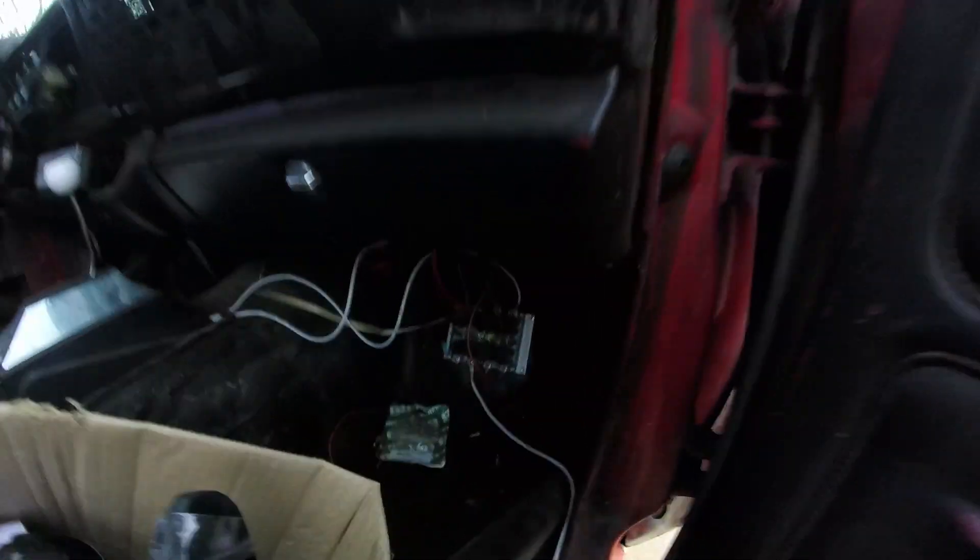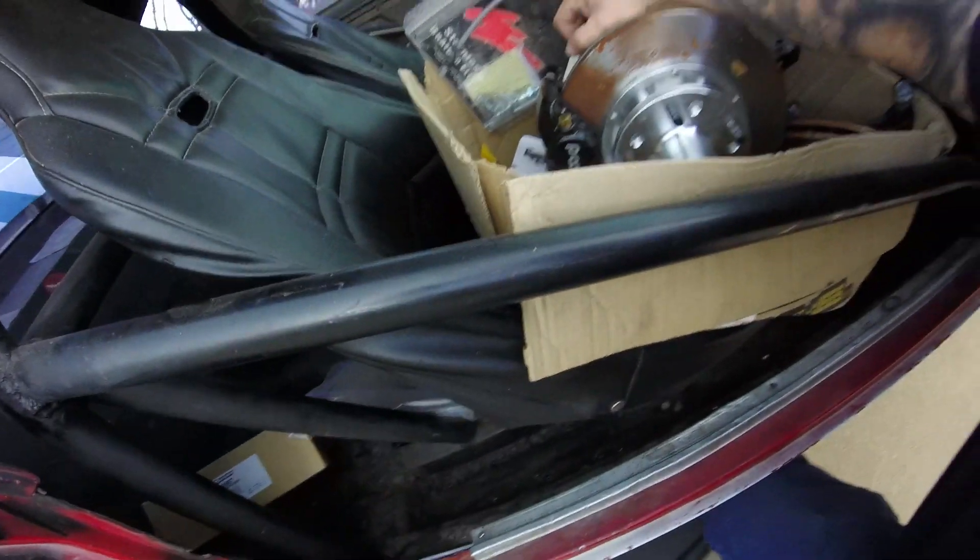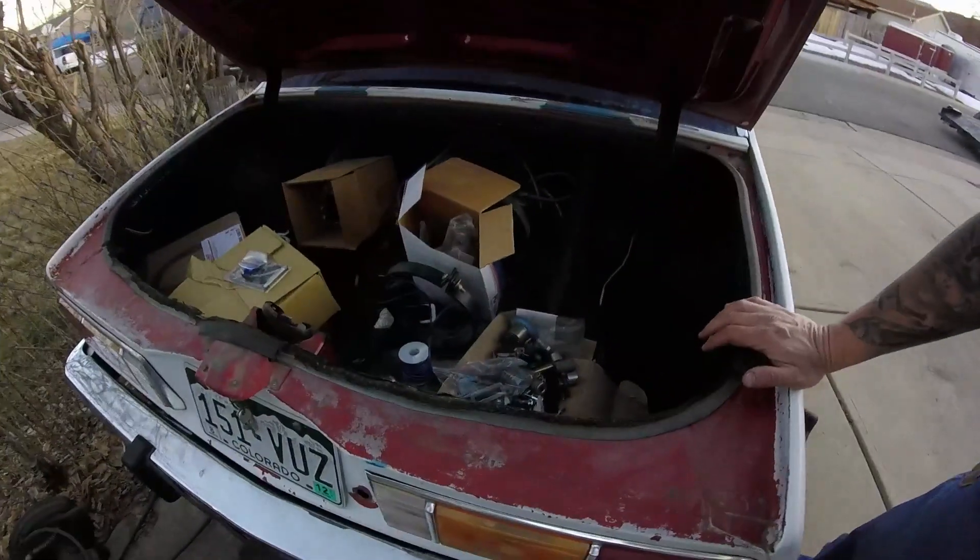No creature comfort at all. It's got one of these ARC auto rod switch panels in it. That's the shifter I had in it when I got it. I've actually got everything here to switch to a Wilwood brake with a 5-lug. The rear's already 5-lug. It's got a 7.5-inch 10-bolt — I got a ring and pinion set out of the Cosworth Vega. It's a 3.73 GM set and then it's got a locker out of an S10 with 28-spline axles that are 5-lug. Here's sort of a trunk — nothing special. It does have a roll bar in it that my buddy John Cavalco put in kind of way back in the day. The guy that bought it after me cut the bars out of it terribly. So fixing all that stuff and just making this into a bracket car.